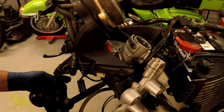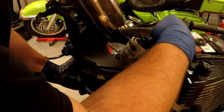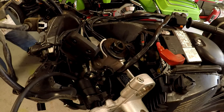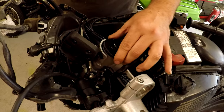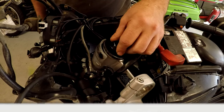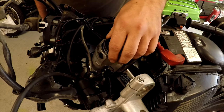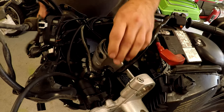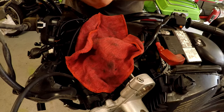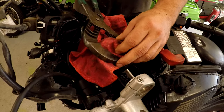Let's slide this back up through. Now we're gonna get the top bearing started and screw it down. Since I don't have the special BMW socket for this piece, I'm gonna do this the old-school way. I'm gonna tighten this as tight as it'll get — collapse the bearings inside, not over-tighten it, but tighten it to where it's really snug. I'm gonna put a rag over it with a pair of pliers. So we're just gonna snug it up — 24 pounds, which is not a whole lot.